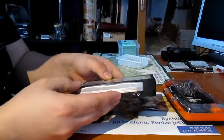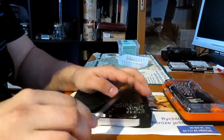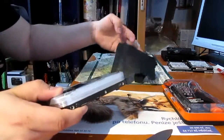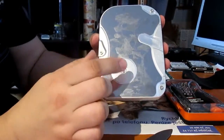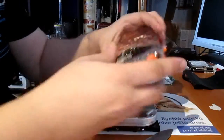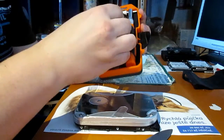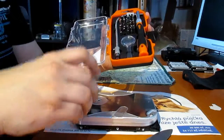For this video I chose an old 10 gigabyte hard drive that was covered with a rubber cover, so the first step was logically to remove the cover. The one and only problem you could possibly have with scrapping a hard drive is these special screws called Torx, so I definitely recommend you buy a set from T4 to T20. Of course the smaller ones are used to scrap a notebook hard drive.